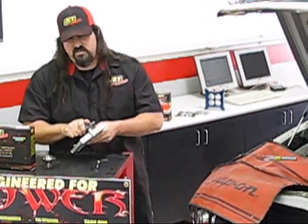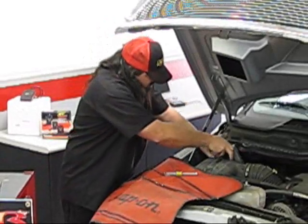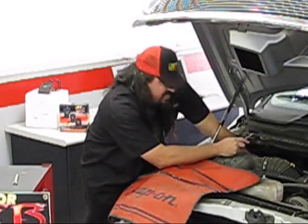You want to get that good clip down. You can't do that while it's on the vehicle because it won't clip both the top and the bottom — because of the way it's angled in there, you only get the top part clipped, and after a while that'll vibrate and run into issues. Once that's in securely and verified it's secure, we've got to put the computer back in. Computer lined up back in there.